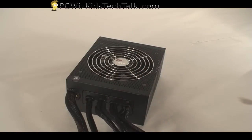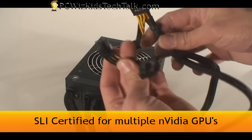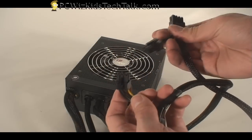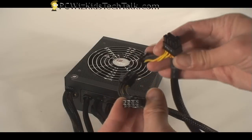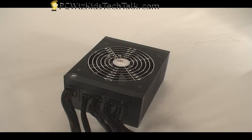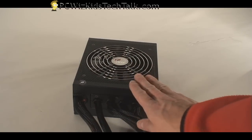The next set is for PCI Express. So if you've got two NVIDIA cards for SLI, this is certified for that — you can connect your 8 and 6-pin to those cards and have them back to back. It's SLI ready, and of course you can use this for Crossfire as well. I have the HD4870X2 on here, which works great.